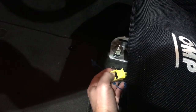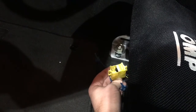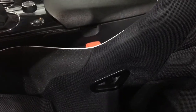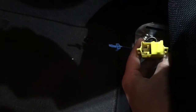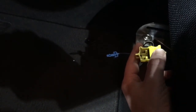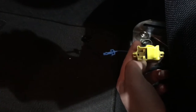...this goes to the seat belt receptacle, the pre-tensioner. I got rid of the factory pre-tensioner and installed a seat belt extender for mine. So if you want your airbag light off, not only do you need one here for the side impact airbags on the seats, but for the pre-tensioner — if you remove that — you also need one for this.